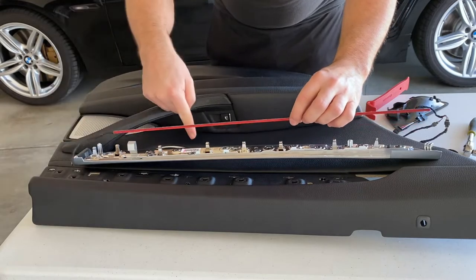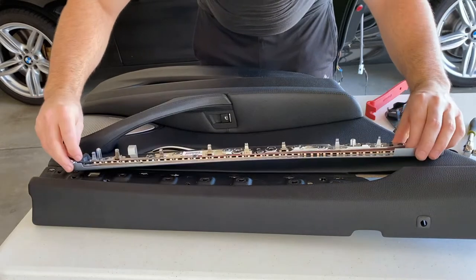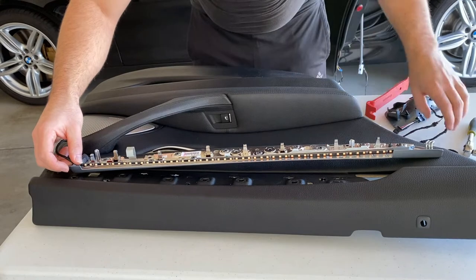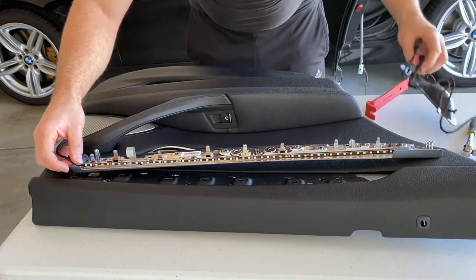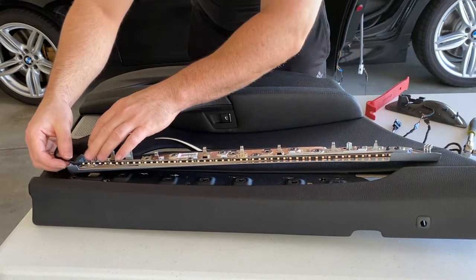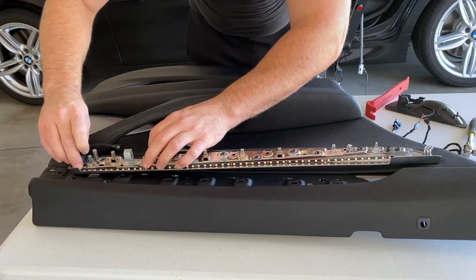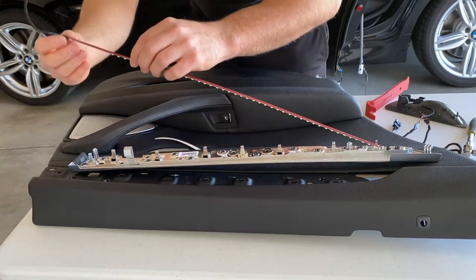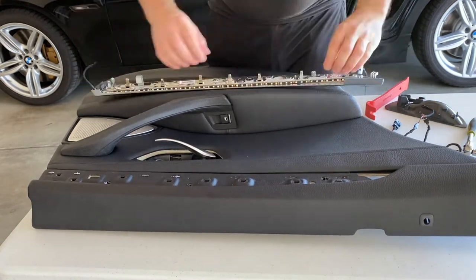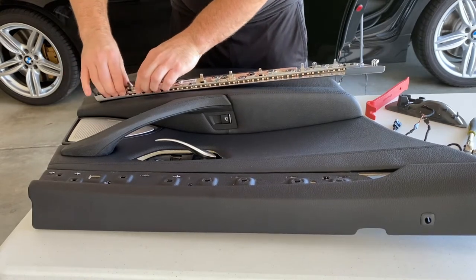You want to have the cable on the front because that's the shorter way to where you need it. Make sure you cover the entire cutout. There's more space in the back for the cable, but since the cable on this one is too short from the release to the back, you're somewhat left having to bend it around on top at the front - not ideal, but it still works. Remove the tape backing and glue it on. On the other side I installed the door panel first before reinstalling the trim.